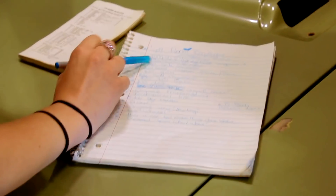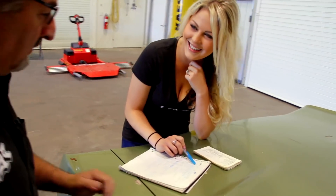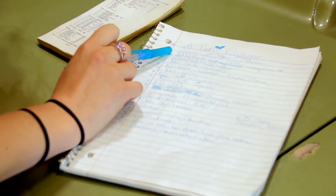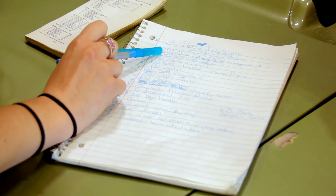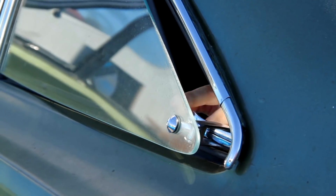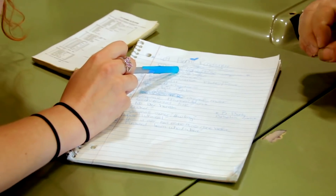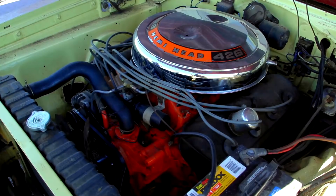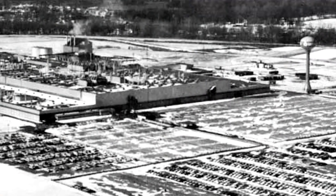The first digit represents the car line. Why is there a heart over the eye on Hemi? Hemi is a man thing — Hemi is punch people in the face. The second digit is the price class, which is medium. 2-1 means body type — it's a two-door coupe. What's the difference between a two-door coupe and a two-door hardtop? On a hardtop, the back window rolls down; on a coupe, it pops out. The next digit is engine — code J. And what does J represent in 1969? A 426 Hemi. What year was the car built? 69. Where was it built? St. Louis, Missouri. You decoded that all by yourself — that's awesome.